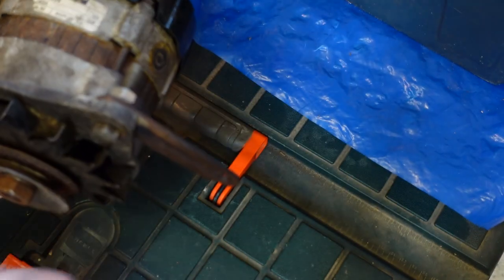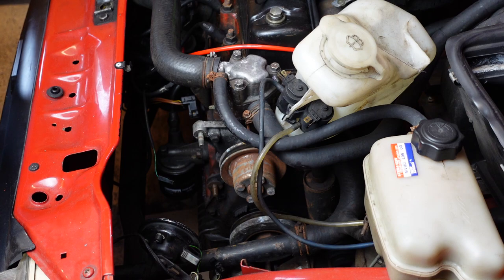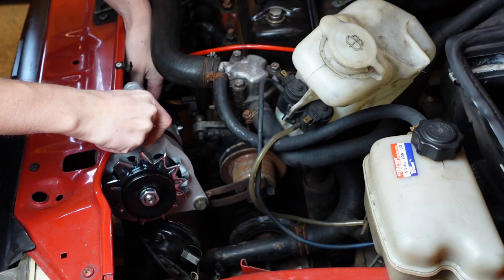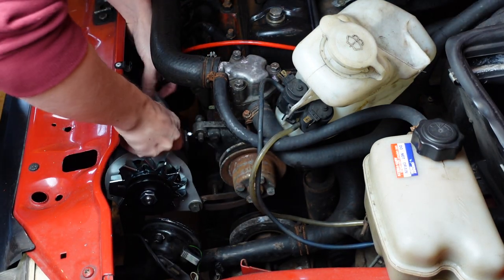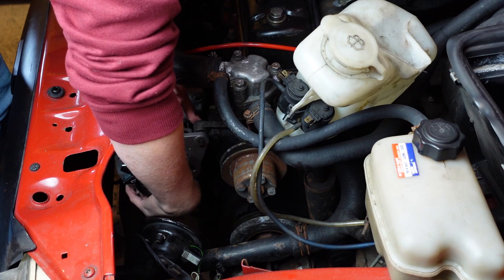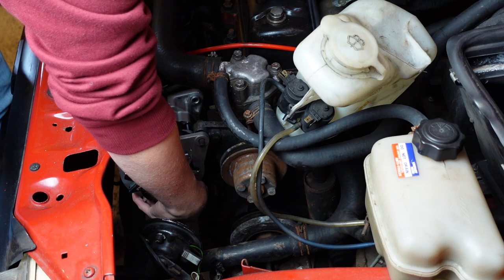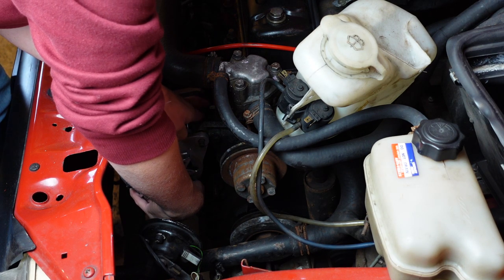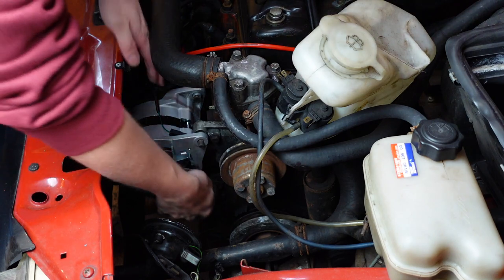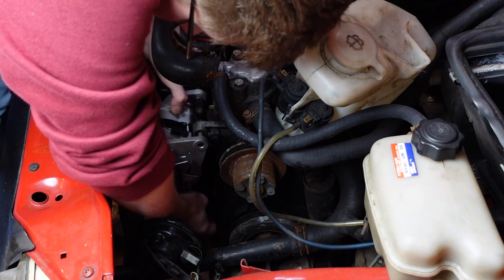So I went and bought a shiny new one that's lovely and silent when you spin it. Before fitting it to the car, I first need to swap over the sliding bracket so we can tension the belt. This is held to the alternator body by another non-captive nut and bolt. Once that's moved over to the new one, we should be able to fit it to the car — but it's never that simple. Rather predictably, this alternator doesn't fit. Even with the built-in adjustment that can space out the left-hand pivot bolt, it still doesn't quite line up with the crank and water pump pulleys. It's not that I've been sent the wrong unit, but unfortunately I went for a rather cheap alternator — they're just like this, apparently. So with the use of another little spacer, it'll fit fine.